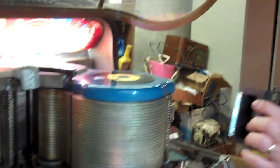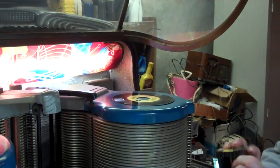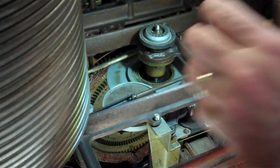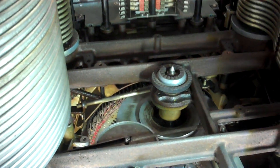You may notice that it also knows if it's a 10-inch record or a 7-inch record, and that is managed by, once again, the same mechanism and the drop of this through a complicated series of mechanical linkages that tell it where the tone arms run.